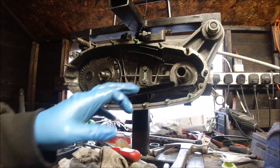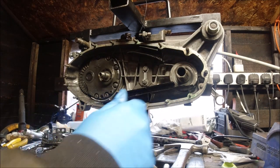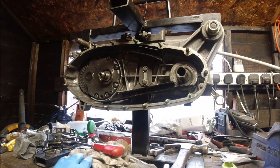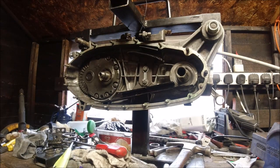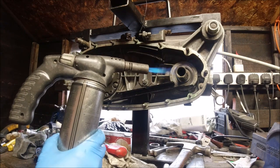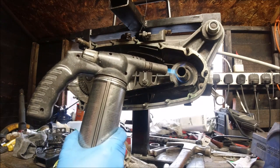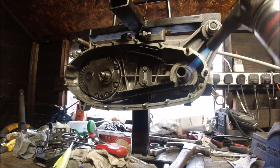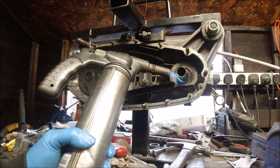This part is on the crankshaft. I'm not actually sure how the tool works because this has got holes in it - whether it pinches and then pushes against the crank. Normally a bit of heat on that will swell it up a little bit. They do normally just fall off but it is absolutely freezing again today. Don't need to take the chain guide off - put a bit of heat into that. It won't need a lot but that will probably do it.